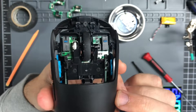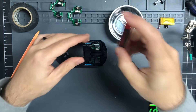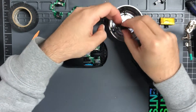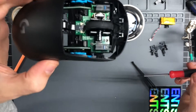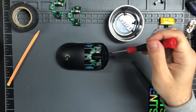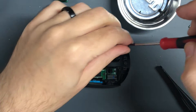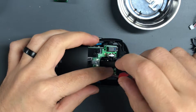And then we are in. It's these two screws and then the four screws on the PCB — that's basically it. These two screws hold the scroll wheel and tension those little plastic clicks, I think. Then these four — all the screws are different sizes, so these are even smaller than the other ones, so just keep them together. If you have a magnetic parts tray, great; if you just have a magnet, that's fine.